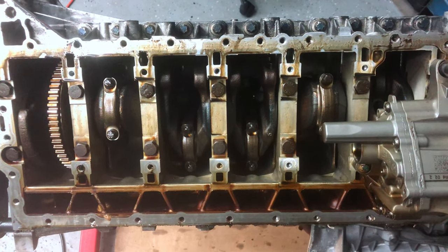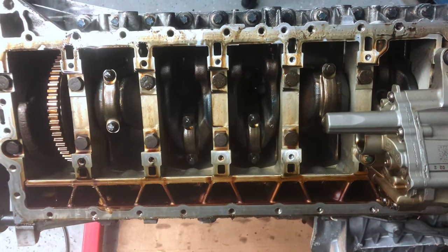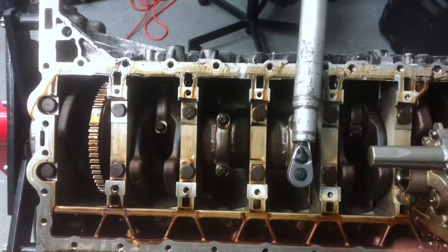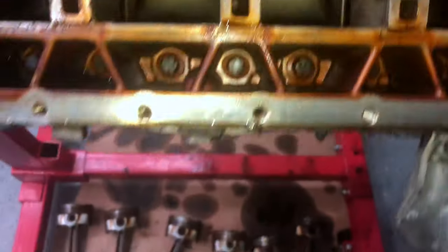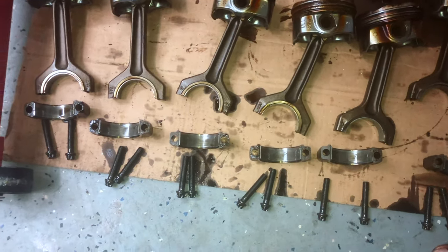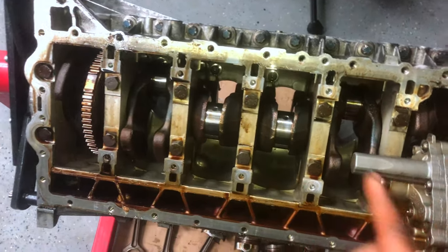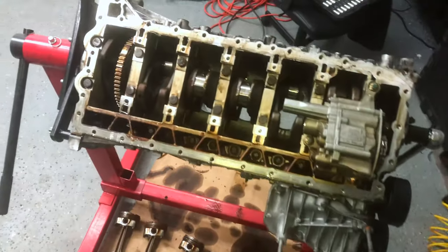I was going to take out all the pistons, but right now I'm just going to take out cylinder three — the offending one — and see how it looks. All you're going to need is an E12 socket with a standard jack handle over it for some leverage. There are cracks in there too. The block itself has cracks, and the bearings don't look too bad, but some of them have some scoring on them. Other than that, all this right here is junk — and I'm about to say the bottom end is junk also, but at least the head is good and usable. So I'm going to need a bottom end.